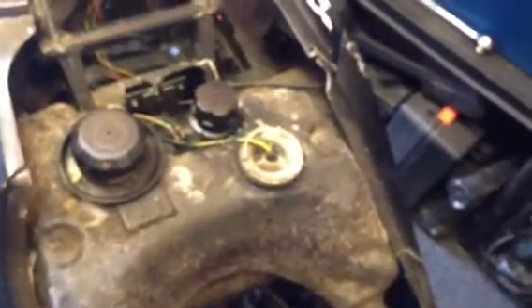So this needs a complete engine rebuild - water out, engine out, really. I might try it half on, half off, I don't know. This is a water-cooled one so I've got to do all the gaskets on this one. Piston's still good on this, great compression. And it runs, it just sounds like a bucket of nails. So that's that one - not a simple job, but I know what to do with this one.